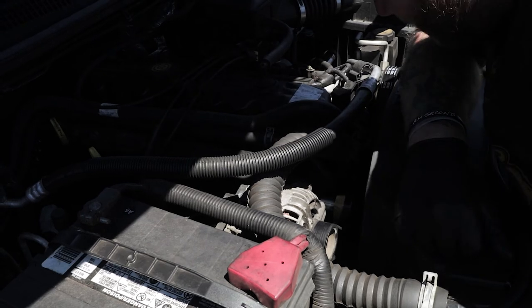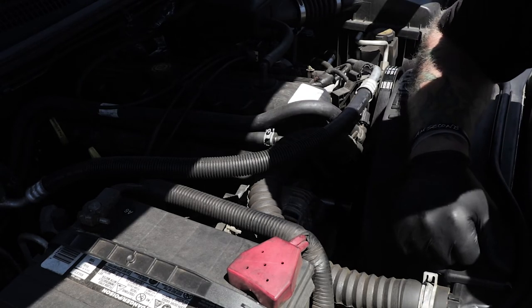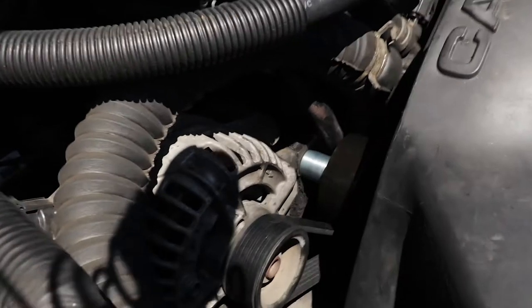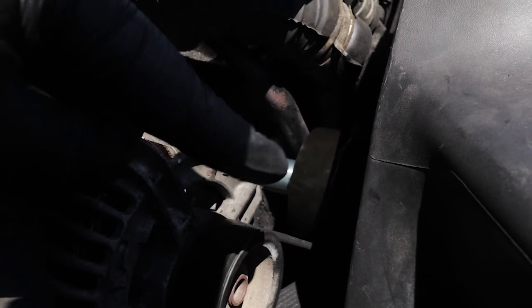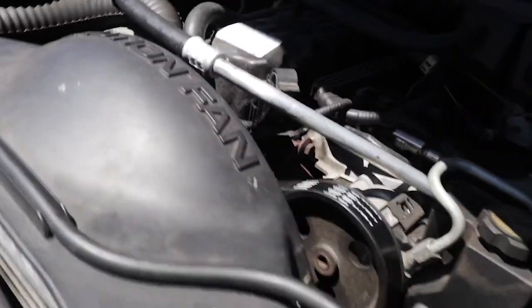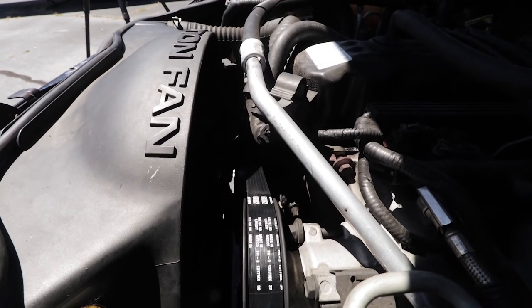But I've been sitting here rambling on and guess what? I'm done fixing the car. There is an idler pulley on it and a brand new belt, so it's time to try to start it. Let's give that a spin. Just for reference, right there at the tip of my finger is the idler pulley I just installed, and here's the brand new belt routed around. New belt installed and everything is good to go. So I'm going to throw you guys on a tripod and turn the key and see if it blows up.